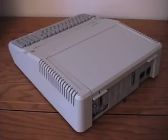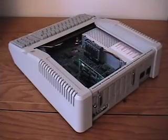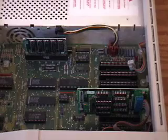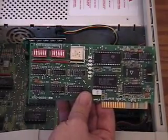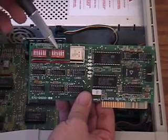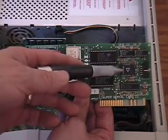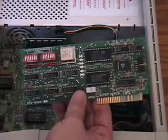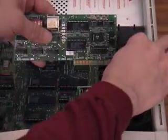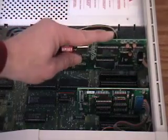We'll start with an Apple IIe computer. We'll lift off the back and add an Apple Super Serial card to it. A Super Serial card has a couple of banks of switches in the upper left hand corner. You can see them here, and you'll find the settings for them on the ADTPro website. Here is a jumper block with an arrow on it. The arrow should point downwards if you have a straight through serial cable, or upwards if you're using a null modem cable. Now plug the external connector in and put the card into slot 2 of the Apple.